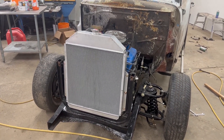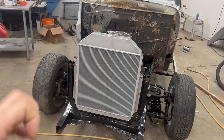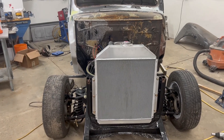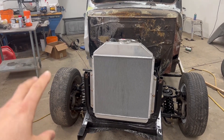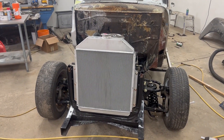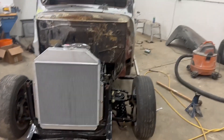Care was taken when it was put together, but it was a struggle to get the springs in at full height. They were compressed from the middle — you had to compress them a lot. I kept having to take it out and get it compressed a little better, moving the spring compressor around, and then finally being able to get it in and thread the ball joints in. Once the spring was cut — not even one full coil — the springs went in the way you'd expect in a vehicle. Compress the spring, it goes in. It's still a big spring but it's not so ridiculous that it's trying to destroy the front suspension.